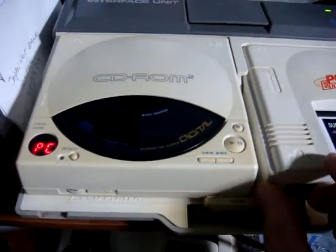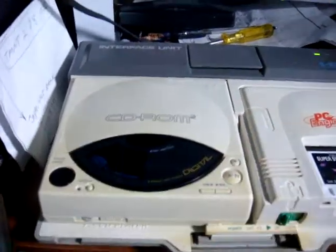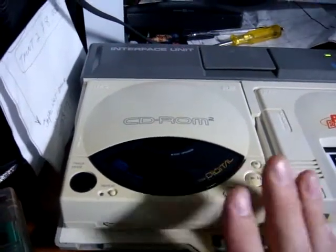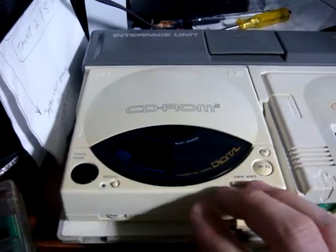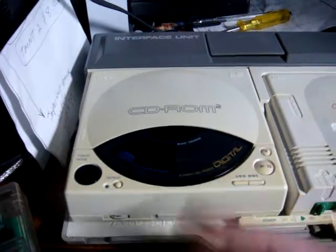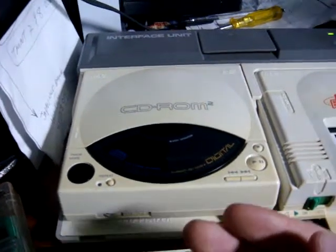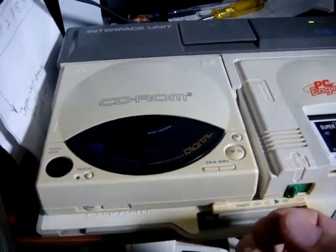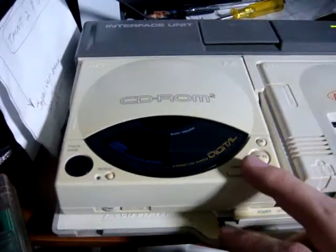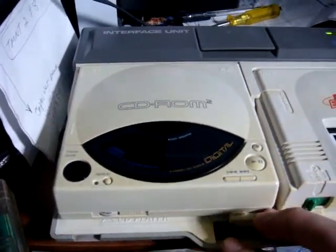What that ticking sound is: it's the sound of the motor that turns the lens — it returns the gear for the lens to move the lens backwards and forwards. If you hear this sound, most likely you're going to have a problem with the middle gear. There are three gears on this lens assembly, and there's a middle gear that causes problems. It's plastic, and if it makes a constant spinning sound it means the gear is probably shaved off, or the teeth are gone — cracked and fallen off, something of that nature.